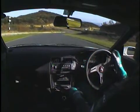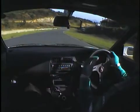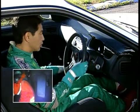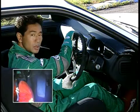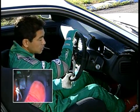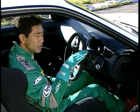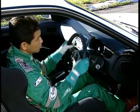Don't worry about how you exit the corner. Just try to pull the e-brake at the corner entrance and concentrate on making the car go sideways. You brake, and then turn the wheel, step on the clutch, and pull the e-brake. Release the e-brake, go into counter-steer mode, then wait. Wait until you know that the car is facing the corner exit direction. Then you gently start stepping on the gas. How hard you should step on the gas pedal should depend on how much you're sliding and counter-steering. All of this should get you to exit the corner in one piece.